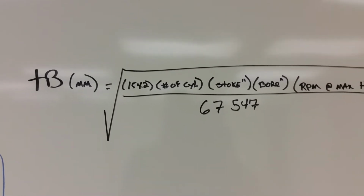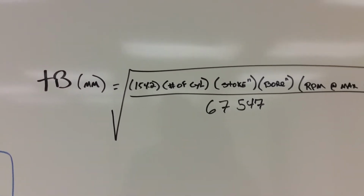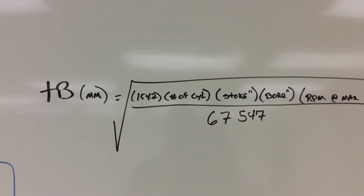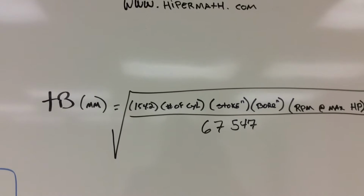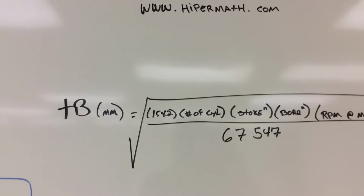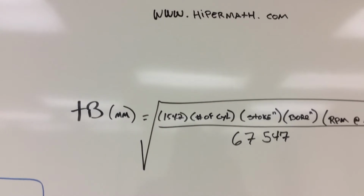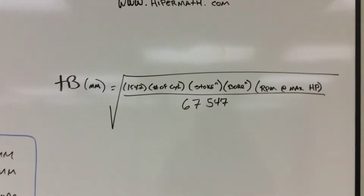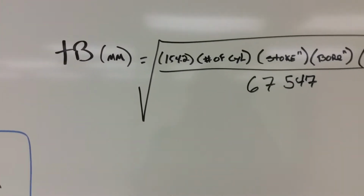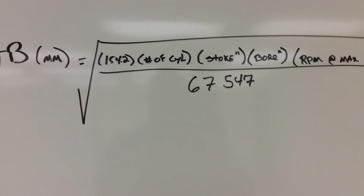I've been doing some calculus to find the best sizing for a throttle body. Yesterday I actually took off the throttle body of a 2.3 in a Mustang. After measurement, it's exactly the same size as the twin turbo V6 for the Fusion, the 2.7. It's 60 millimeters. So this is the equation you need to do to properly size a throttle body.